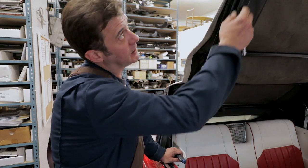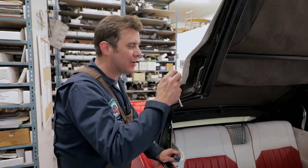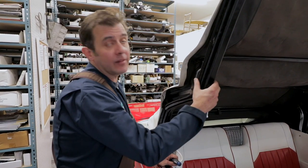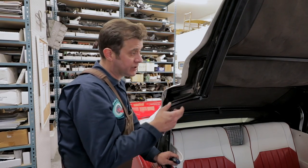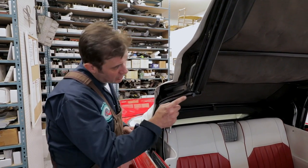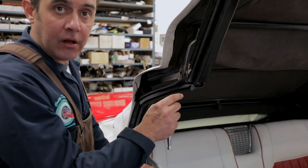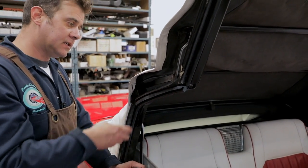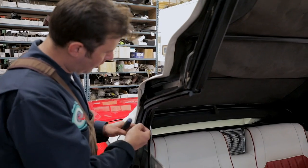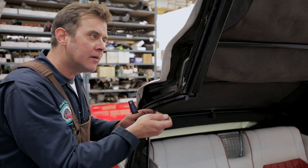We now have the three pieces on this side — we already installed on the driver's side. There's a lot of adjustment that goes into this: adjustment of the windows, the regulators, and the top. I like to loosen all the bolts, get it adjusted, snap it on there, and go back and tighten it up. You might also have to trim just a little bit off the end depending on the condition of your top. Best thing is to go through, tighten up the nuts, insert the screws on the ends, and be prepared to play a little bit with the fit.